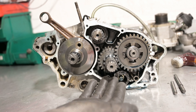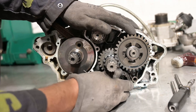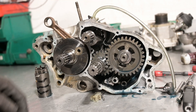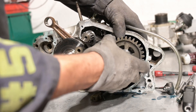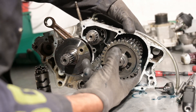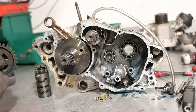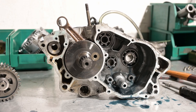You kindly ask the bolt from the shift drum out and remove it. Take out the gears in one piece — since that is a puzzle, you'll need a manual for that. No need for violence here. Counterbalance weight out and you're left with the crankshaft.